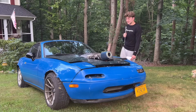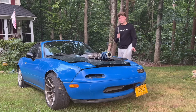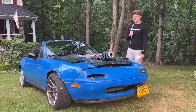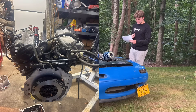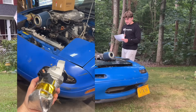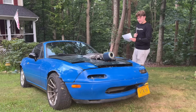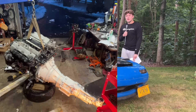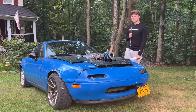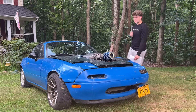In all honesty, it's not that much different from swapping in a BP, just because you're keeping the stock drivetrain. It's nowhere near something like an LS swap where you have to take the whole car apart. The Stage 2 kit I purchased from Gary over at Oz Engineering includes the adapter plate and crankshaft extension that utilizes the stock Miata 5-speed. A 2014 Honda V6 Accord starter mounts to the lower left side and includes a mounting bracket that bolts right up to the adapter plate.